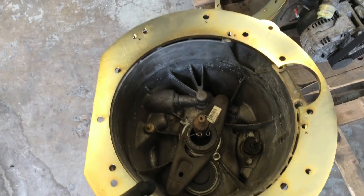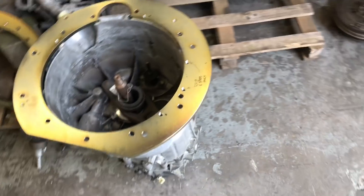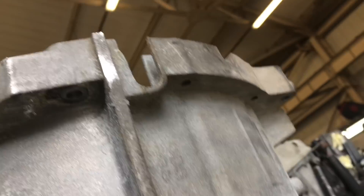On the 6-speed 37DZ, it is in some cases very important to enlarge some of the holes, simply because from the factory the BMW holes won't accept an M10. Like this one and this one — they're only a very small hole — so we have to enlarge them to 10.5mm just to take the M10.